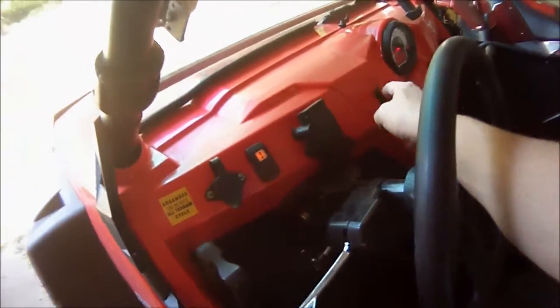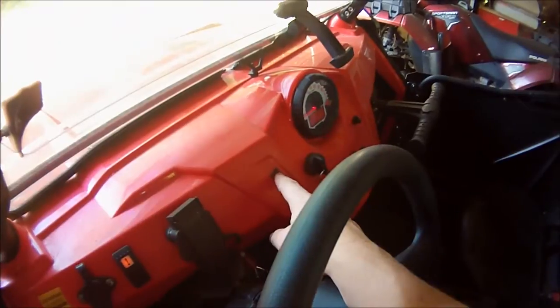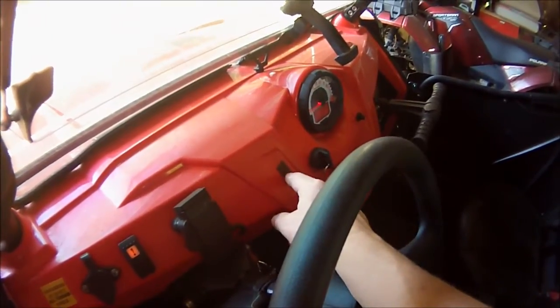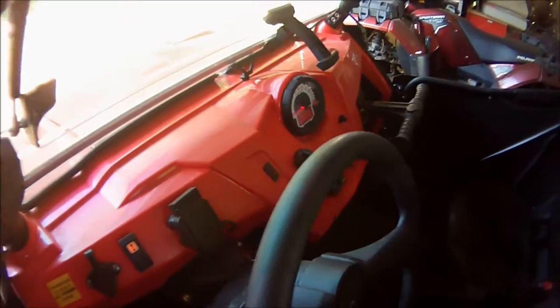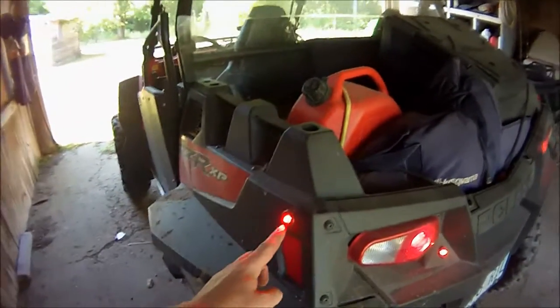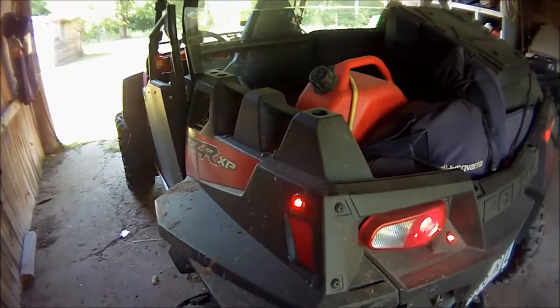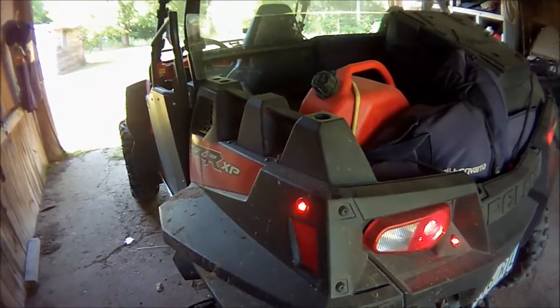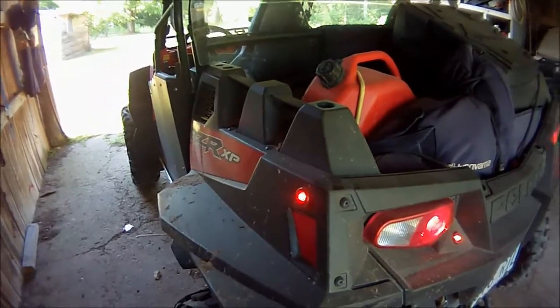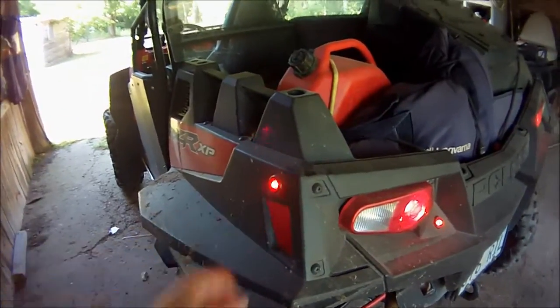So what I've done is put a switch up here on my dash. It's a three-position switch — if I go to the upper position, that gives me my park lights. And per the law, my park lights are clearly visible from the side. I actually found these at a farm supply that helps outfit a lot of big cattle trailers, you know, farmers that haul cattle. You can also find this one at a truck stop.